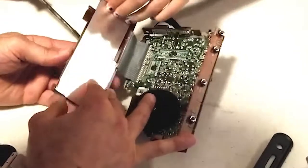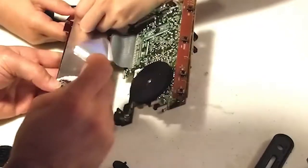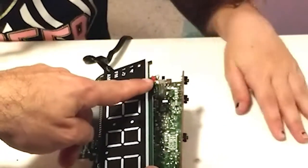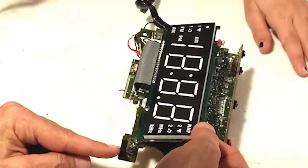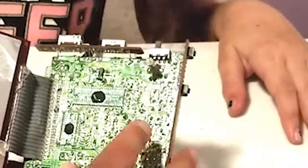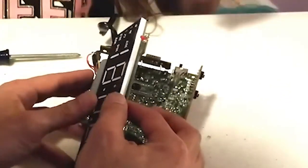If you want to try to pull that off — it bends very easily, it's a very thin foil with an adhesive back. A couple more things to identify on here: we have our red LED, which is our FM stereo indicator. We have our earphone jack, so if you want to do some private listening. And then we also have this, which I'm guessing is a cadmium sulfide cell — a light sensor. As you can see, it says 'sensor' on it. Most likely, when you are in a brighter lit room, the display will be a higher intensity. When you turn off the lights, this can automatically sense that and the display will dim, so it's not bright in your face keeping you awake at night.